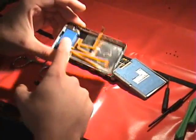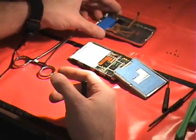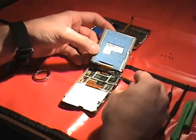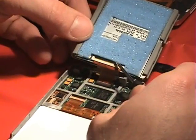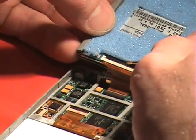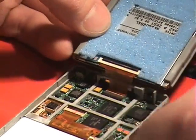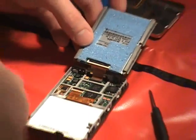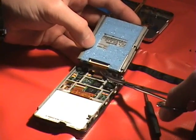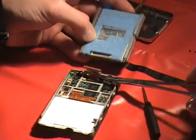This is the battery — if you need to replace it, you can simply do that at this point. Rotate and take a look at the hard drive. You'll see a black clip holding the orange cable in there. Flip that clip up, then grab your forceps, take hold of the orange cable, and disconnect the hard drive.